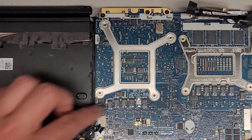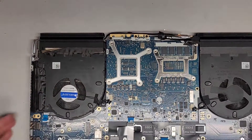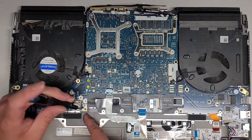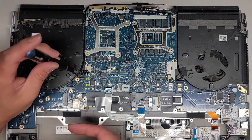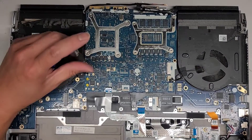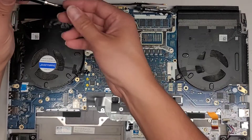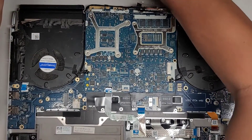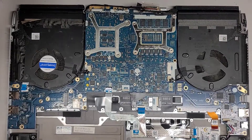The wireless antenna we do need to flip over here. Let's zoom out and then we're going to take all the screws out from the motherboard. There's a fan screw here — we'll remove that one as well. These are all different sizes, shapes, and lengths; the fan screw is much bigger, so don't mix it up. Then we have another screw in the motherboard here — also a small, short one. Most of these screws have little arrows pointing at them so you know where they came from. It's always a good idea to put the screws in order so you know where to put them back.